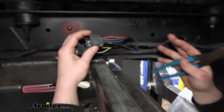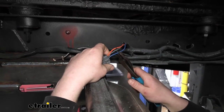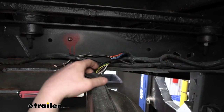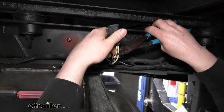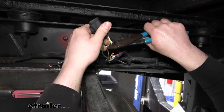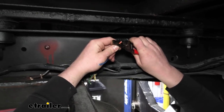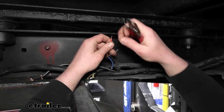Since we're going to be hardwiring our seven-way connector end, we need to get rid of these factory ends. I'm going to cut them one at a time and leave enough wire off the back of the connector — that way if you ever did want to hook them back up for whatever reason, you still have that opportunity. So clip those off and do the same thing for the other one. Then once all these are clipped, we can strip back the insulation. I'm going to do that to all seven wires. Once you have it stripped, I like to give it a twist so all the wire stays nice and tight.